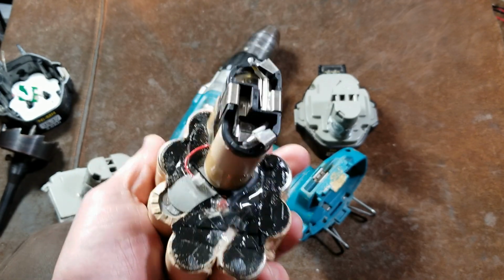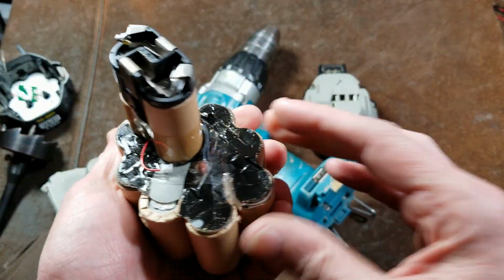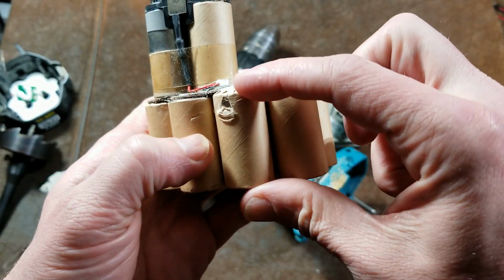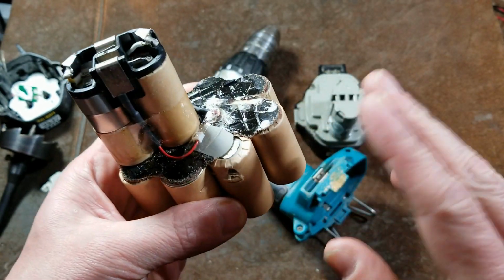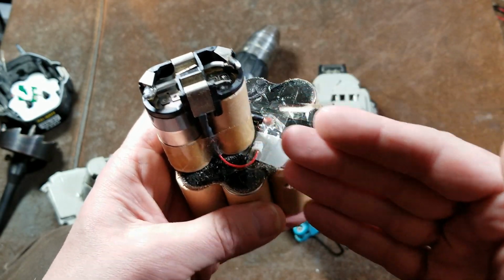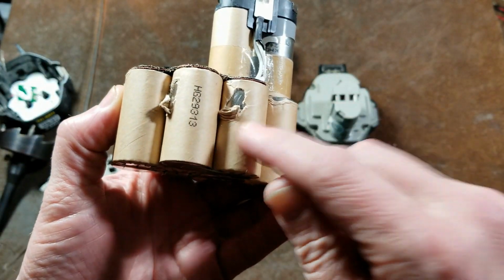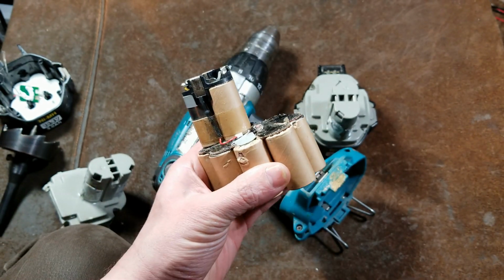One of the worst issues about these is we know on modern lithium-ion, they do balancing, where the charger actually has wires going to every single individual cell in the lithium-ion to make sure one battery doesn't get overcharged or is constantly being undercharged. The issue with these Makitas is there's 12 cells, but there's only one balancing point. So it's charging basically two 7.2 volt battery packs, and inevitably one of the cells starts getting weak and it has no way of compensating for it.